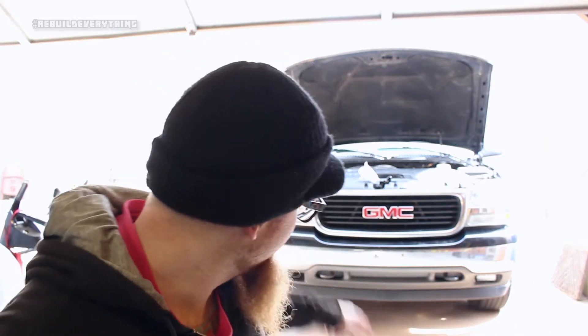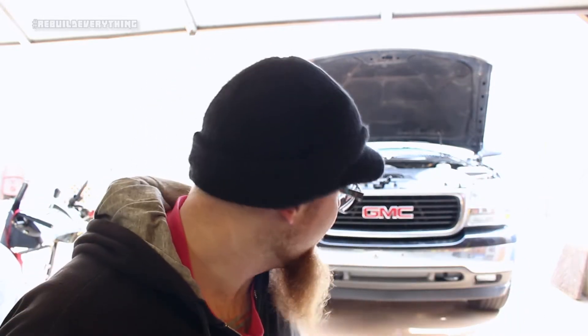Or one of them did at least. The one on the left side decided to stop working. I tested it off a couple different 12-volt sources — put it on the charger, the battery, a little bench tester. It doesn't work; it occasionally flickers but will not stay lit. So something internally died on it. I don't know enough about how they work inside to bother fixing it.